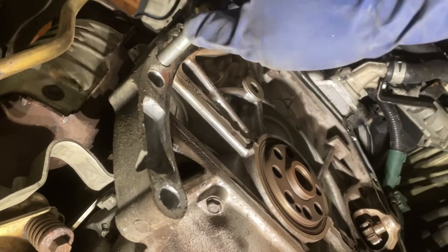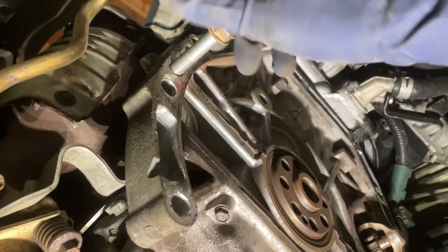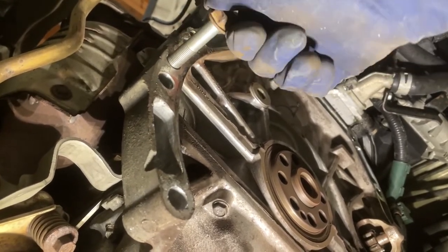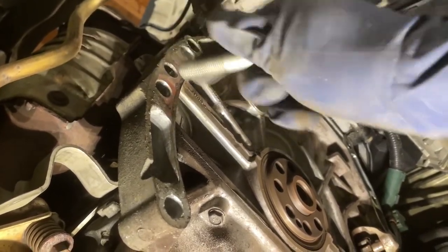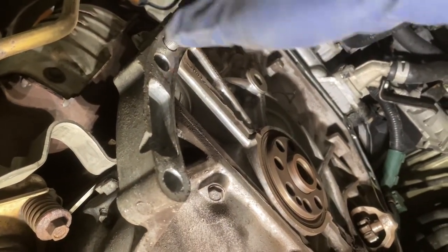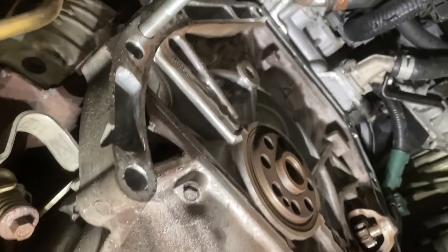You know, and if you're putting this transmission on and you don't ever plan on it coming off again, then I guess that's not a problem, but you know, the clutch is always going to wear out sooner or later. So, when I went to take these out, they got jammed in there and took me a long time to get them out with my impact wrench, which is fine when you're removing them. But when I put these bolts back in, I'm going to follow the torque specs so I don't strip them out. That way, if we ever have to service this again, they'll come out easily.